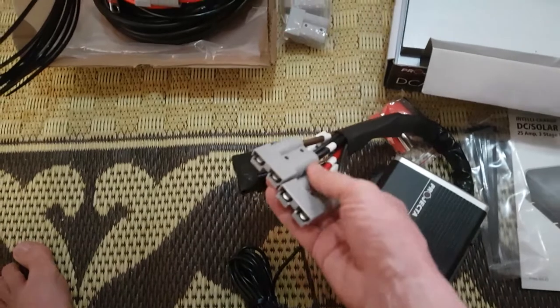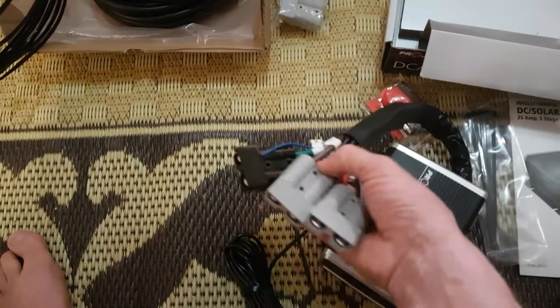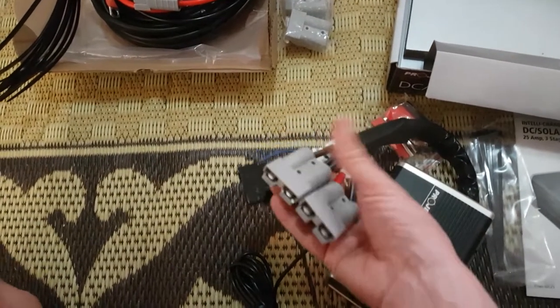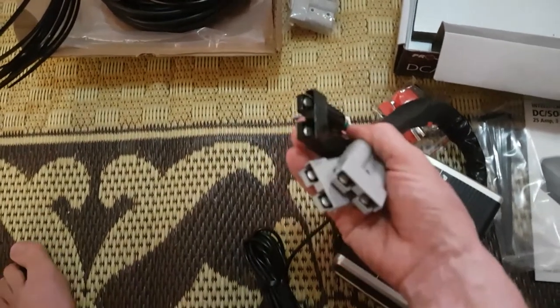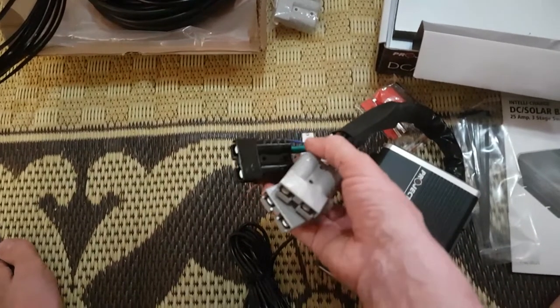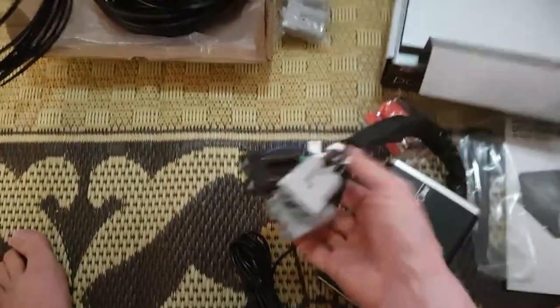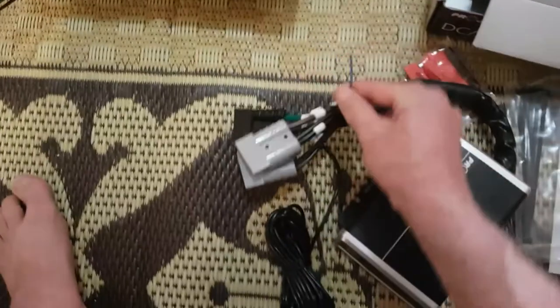The black plugs are basically operable with the gray. Then you get all the other colors — reds, yellows, greens, and so on. However, they're not interoperable with the grays or the black. So if you've got a red one, it's got to go red on red, green on green, yellow on yellow, blue on blue.